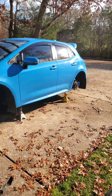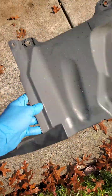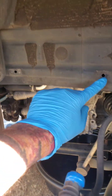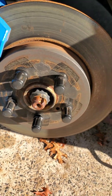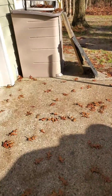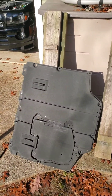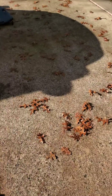I have all the wheels off because I'm doing a tire rotation as well. This panel here covers this area up in here — there's a couple of push clips and a bunch underneath. When you're taking that off, you're also going to want to take off the under shield, which is held in place by one or two 10 millimeter bolts and a bunch of those push clips all around the outside.